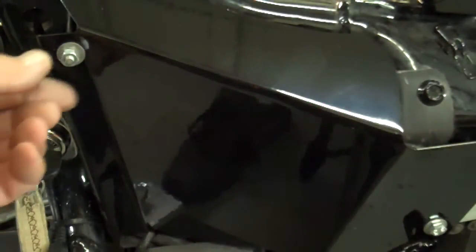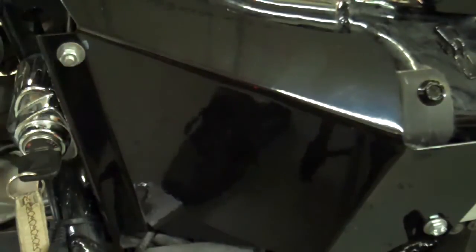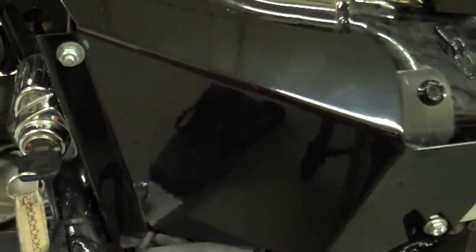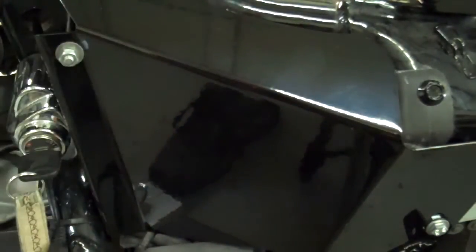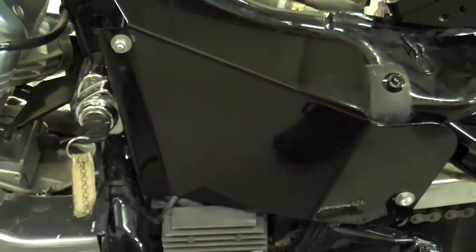Go ahead and run the nylock nut on this side — just barely past where it engages onto the metal so you don't see too much of the stud. Then on the back side, put the nylock nut and the washer. Make sure you use the washers on both sides because it'll make it fit a lot nicer. Tighten it up to where it's a little snug, but don't get it too tight because you might bend the little flange in the back. Just tighten it so it doesn't rattle. I painted this screw and the stud black so you can't see it — it looks a lot nicer. That'll make your older 600 Shadow look great with those side covers. Enjoy and ride safely.